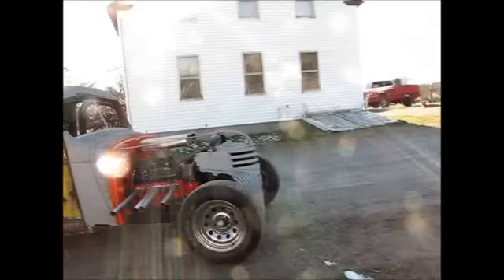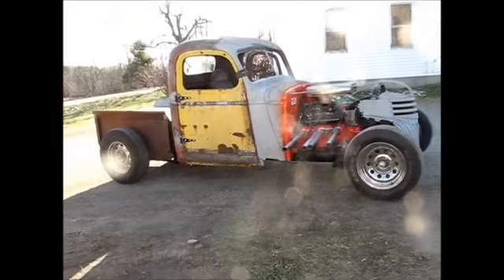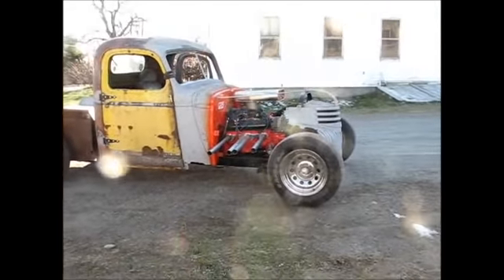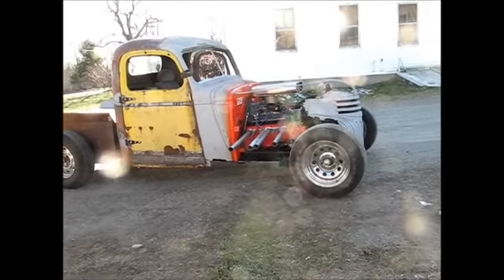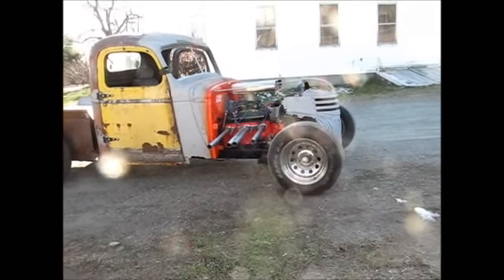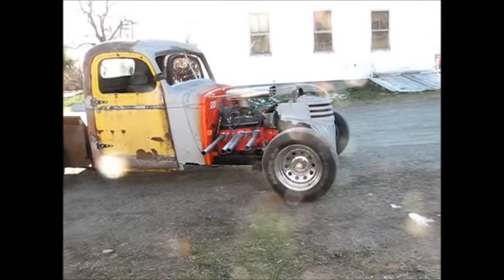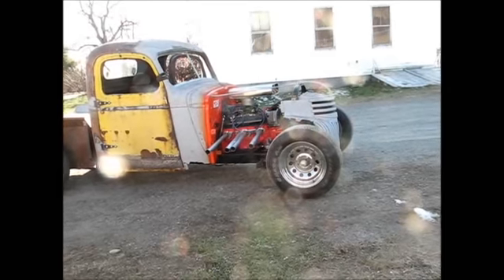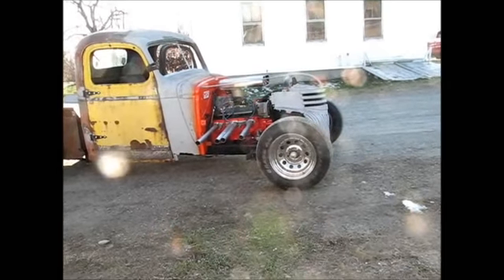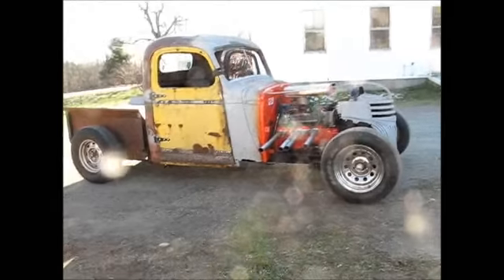What we had before was we couldn't get the back brakes to work. We ended up fixing that some last night and some this morning. The front brakes were taking over — you'd go down the road, hit the brakes, and she'd just keep right on plowing. I don't think this thing would power brake anyway because I think it'd just push right through it. But I don't need to power brake it.